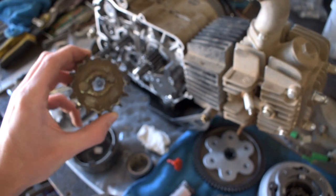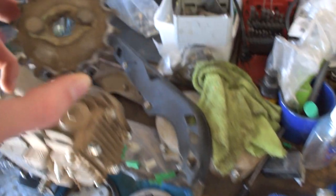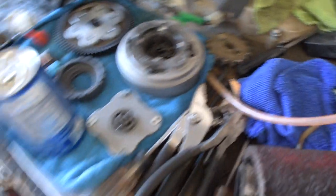If you want to make your pit bike faster for really, really cheap — like $11 cheap — it's gearing. Get an upgraded sprocket for the motor with a different tooth count. The higher tooth count you go up in the front, the more top speed you get; a smaller tooth gives you more acceleration. Don't jump too far — I went from a 14 tooth to a 16 tooth and there's a noticeable 10 mph top speed difference, and you notice it through all the gears. I have a video on how to install it, linked in the corner.